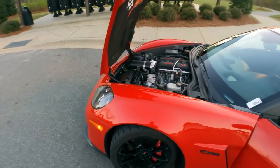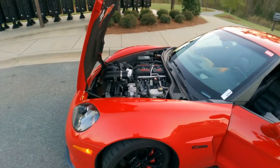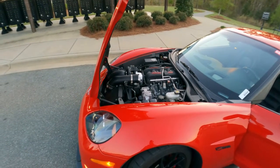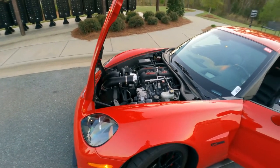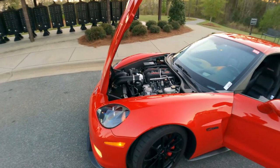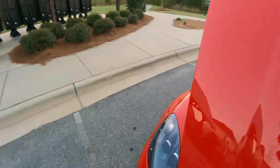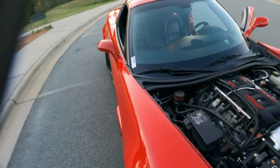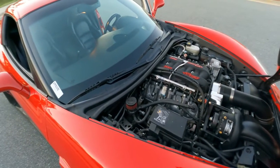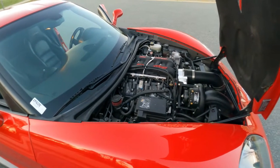So if you're on a budget like I was, because I had just replaced my LS7, obviously I went with the ECS kit, but everyone that I know has ANA kits. John Speed Automotive, the guy that built the setup, he put an ANA kit, or is putting an ANA kit, on his C5Z. And then I would say one thing that is absolutely a must on these cars, even NA, is a catch can. I run the Mighty Mouse to delete the PCV. Otherwise, on the top of the pull, you're going to get a little white smoke from the blow-by.